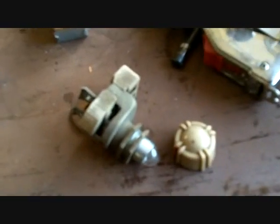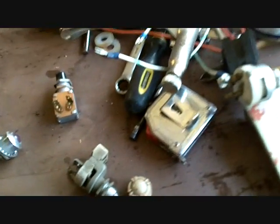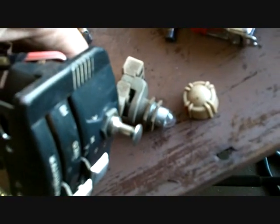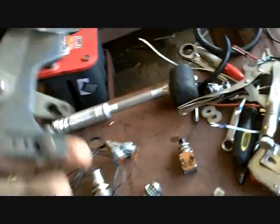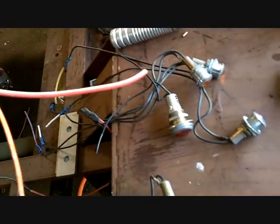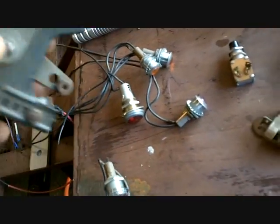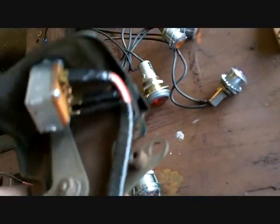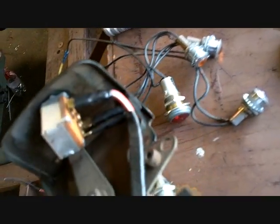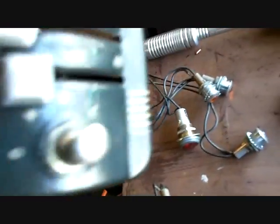Moving right along. Hey, that old switch that was on my heater block. Nice knob, too. Junk. So what I did is I put one of those matching two-position switches. Three leads, power in. You know, like, could be low fan, high fan. That's all we need. Three wires coming out. Of course, red is power. But I got it all tied in there. Got a wire tie holding the wire so it doesn't rub on anything. And everything's taped up and shrink tubed and you name it.